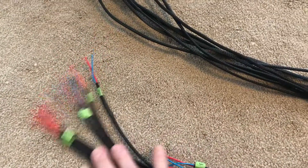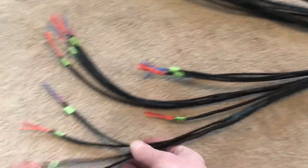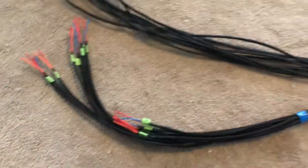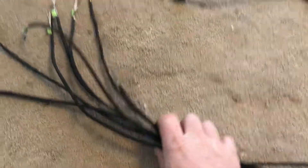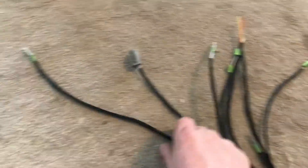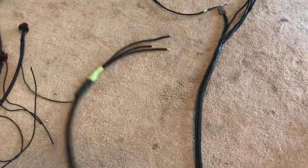The injector harness is all done up — got 12 injectors to wire in, still waiting on plugs for those. The harness breaks out to some more sensors: some pressure transducers, TPS, and some other fun stuff. That'll come back inside the firewall. This will be outside — there's coil ground that'll connect to the engine block.